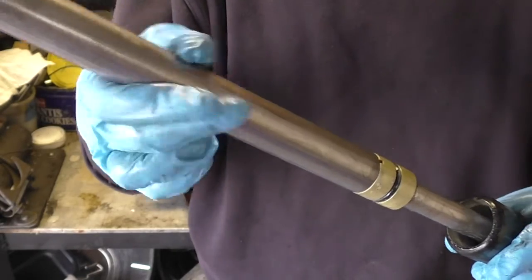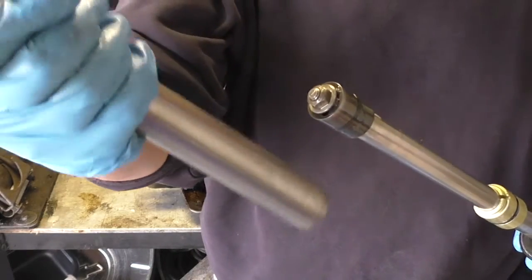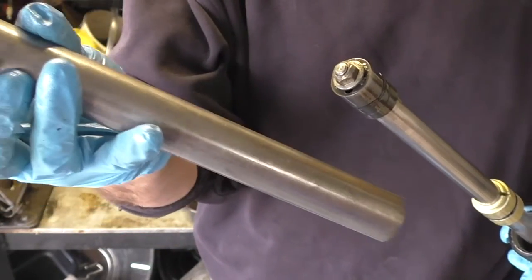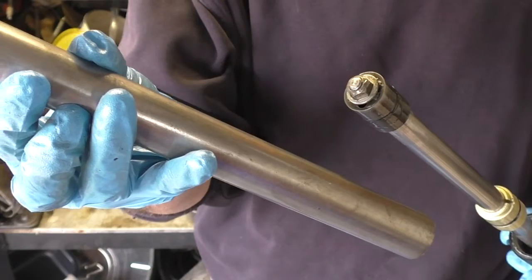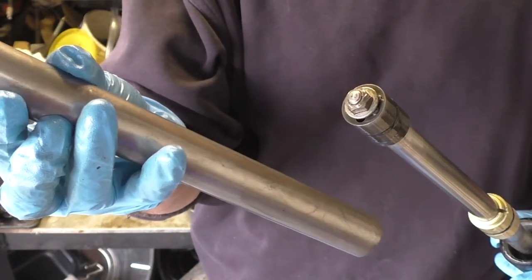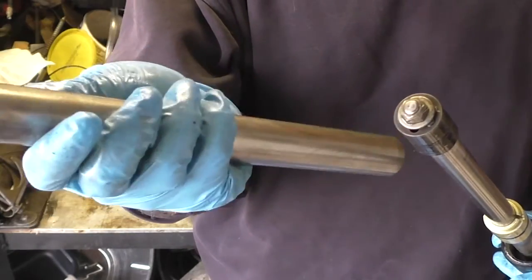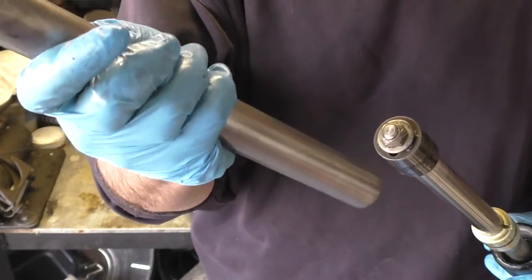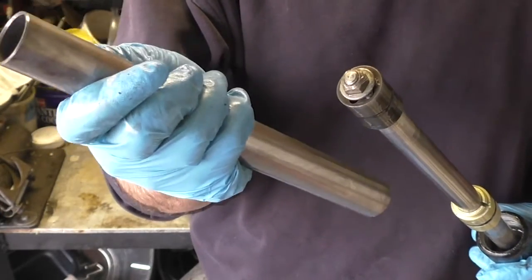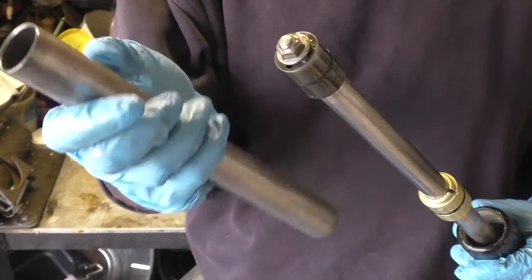Then you remove this outer tube, and this is where most of your pressure gets absorbed. That thin little tube on the outside, it's aluminum and it's not very strong, and it's never going to hold pressure, and it corrodes and you get pinholes and all kinds of problems. This is where your pressure is being generated, inside this inner liner tube, and this comes in both types of rebuilding kits, and we'll get into that in a moment.